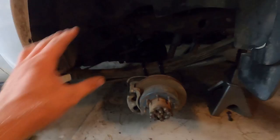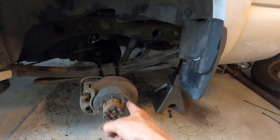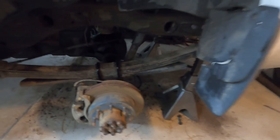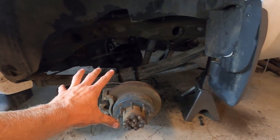I wanted to show the rear axle first. I picked up a Duramax rear axle, which is the 11.5-inch from a Duramax — this is from an '01 to 2010. I wanted to make sure it was from that range so it bolted right in with no problems. We hooked up the factory e-brake cable and obviously the brake lines. I did have to get new U-bolts because the Duramax axle leaf spring pad is taller, so you cannot use the Suburban U-bolts. You should replace U-bolts anyway since they are stretch bolts.